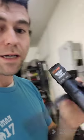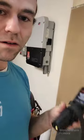Now this is about a $300 part. I got it used on OfferUp for about $100. The idea is that you just plug this into your vehicle, plug the other side into your tow hitch, and then set some of the settings on your Bluetooth on your phone, and you're good to go. You can also pull up the app and apply the brakes manually if you want, or you can just set it and not worry about it, and it applies it, and it's pretty good there.